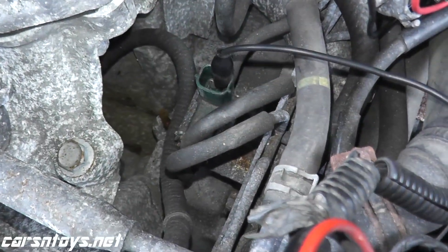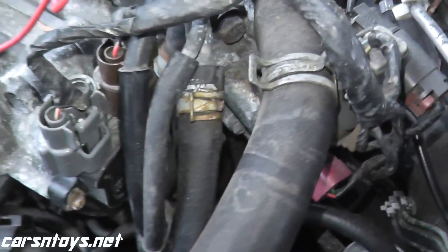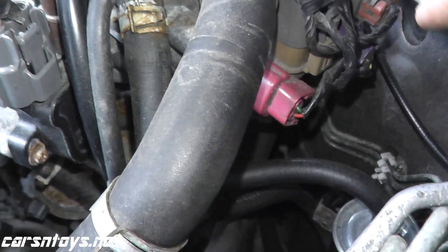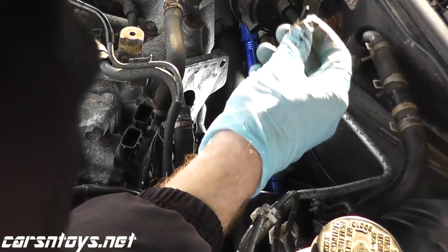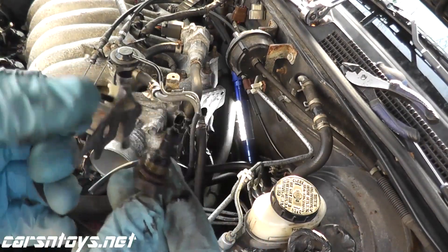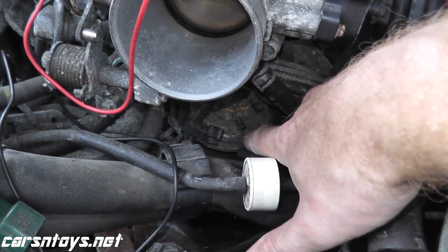Since this is an older vehicle, we can test the EGR temperature sensor. There's a wire and a sensor you can physically remove from the vehicle. I have a separate video on how to access and remove that temperature sensor — I'll include a link in the description box below. But again, chances are if you're getting P0400, it's the vacuum line or the EGR valve itself.